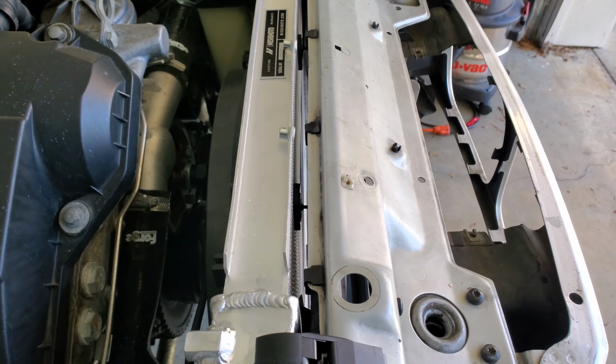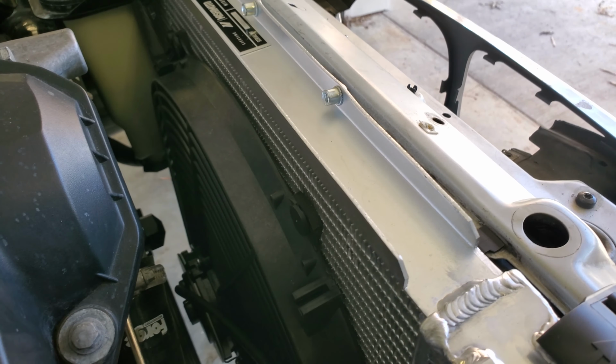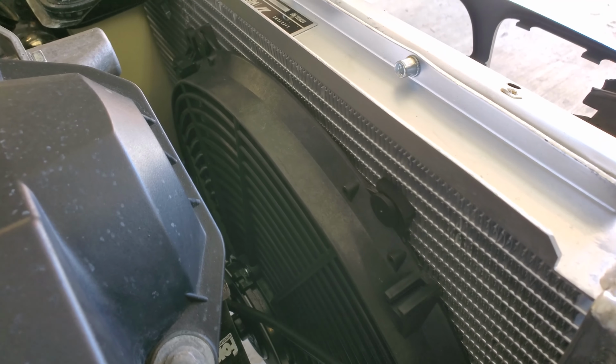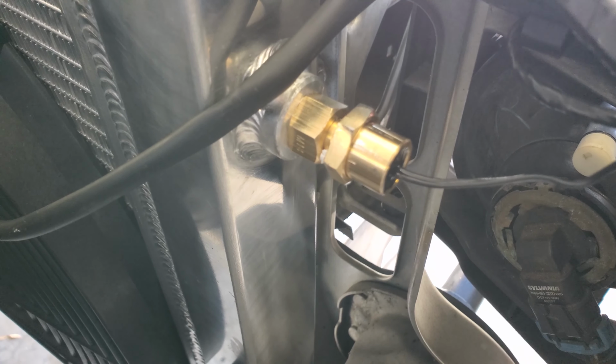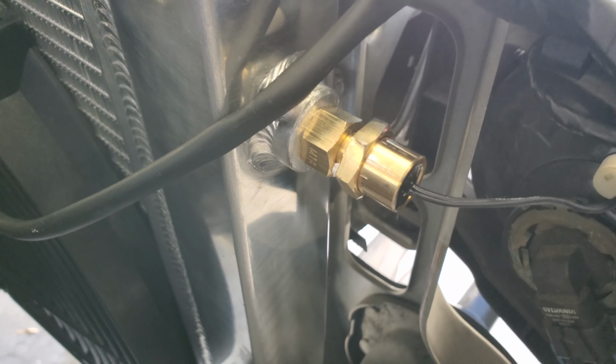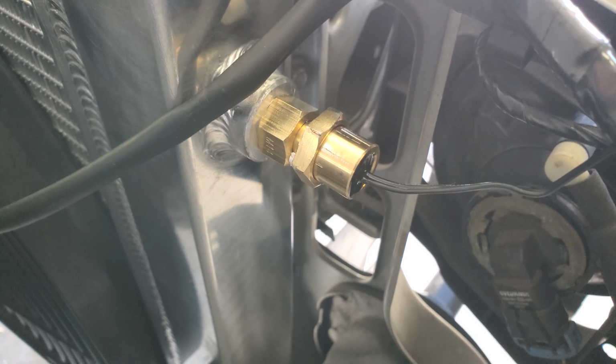These other zip ties are special, like fan zip ties. These ones feel a lot better than the Mishimoto ones. I'll put them in the description. And then the fan feels very secure here. On this end, we're going with the NPT probe, as opposed to the one that just pokes through the fins. Hopefully that'll help prevent messing up any more of the fins on this new radiator.